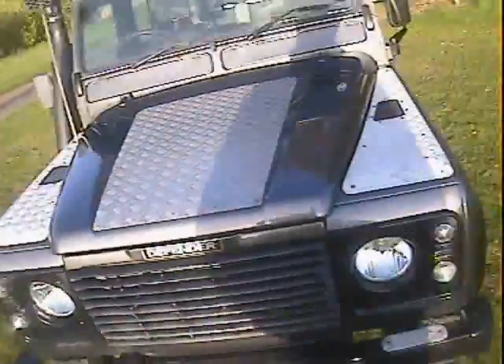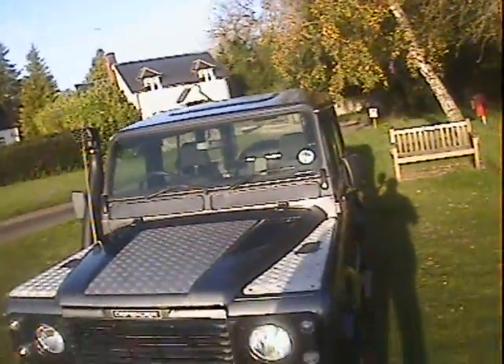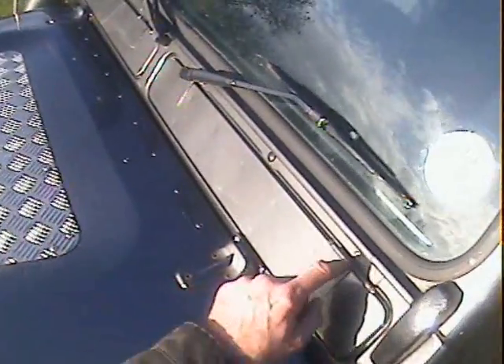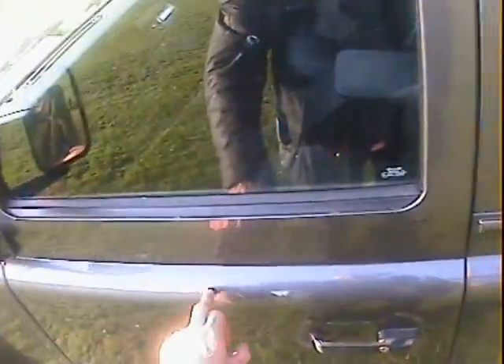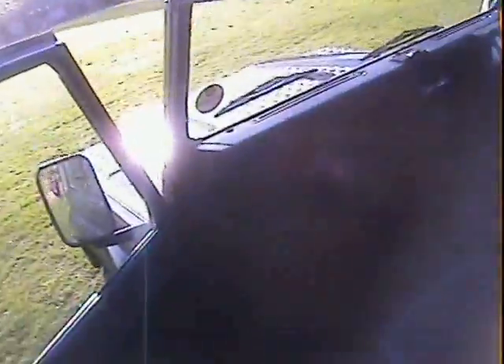Presumably it's had a roof rack on at some point and someone's used this to stand on. Around the front end it's all okay. Looking down the sides, apart from a few dinks in the barrel side on the passenger door, the nearside front wing looks fine. Scuttle corner all looks very good indeed. One tiny bit of bubbling just coming up by the vent hinge but it hasn't broken through. Screen looks fine, roof looks good, A-post looks fine. Nearside door — there's a few dents in the barrel side, obviously where people have closed it incorrectly, and a little bit of electrolytic reaction. Looks like it's been touched in just down there on the base of the nearside door.